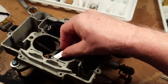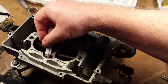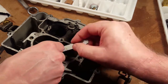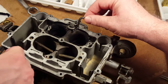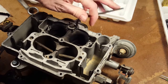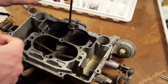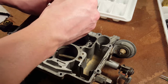There's this gasket, so. See, that's damaged quite a bit. Good for changing it. White paper. Good. So a little carb cleaner will get the rest. And next is this one. Already loose. Wow, that's not very tight. Maybe the gasket has gotten thin. It's loosened it. They shrink.